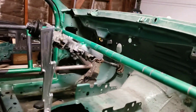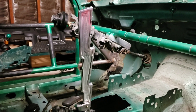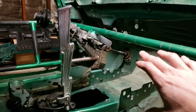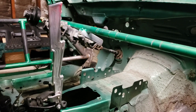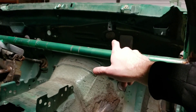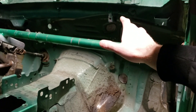I have to make a rear firewall cover, probably cover up that deck lid too. Just little things — you can see there's no pedals or anything in it right now, just the steering shaft, which is still in here so you can move it around and steer it. But it's going to get a pedal box — no more stock pedals. I'm really going to try to do a hanging pedal setup so there's still hanging pedals and not on the floor. I really like the inverted pedal feel. I've got to cover up all these holes in the firewall. I've got some panels I did before but I think I'm going to redo those, probably weld something on. Then I can use those holes for bulkheads too. I might actually change them to bolt-on.